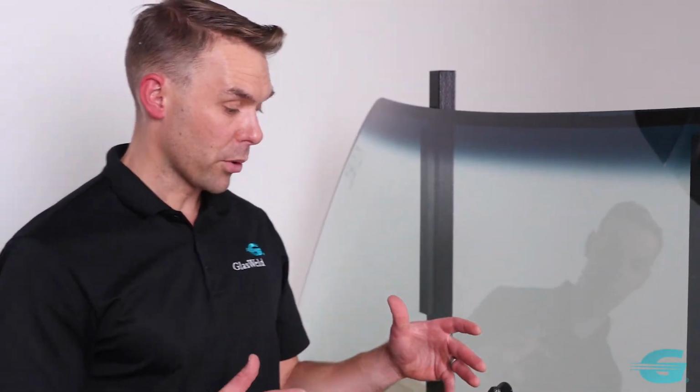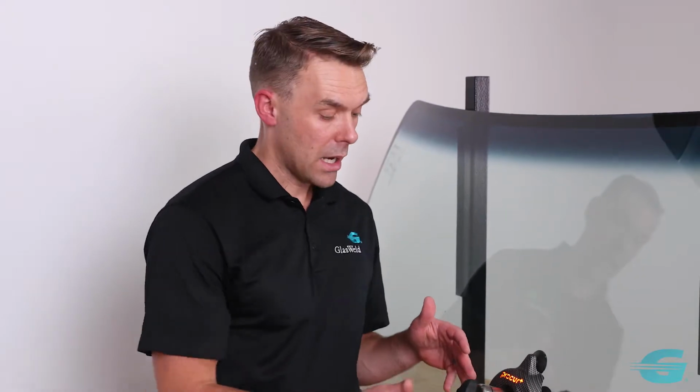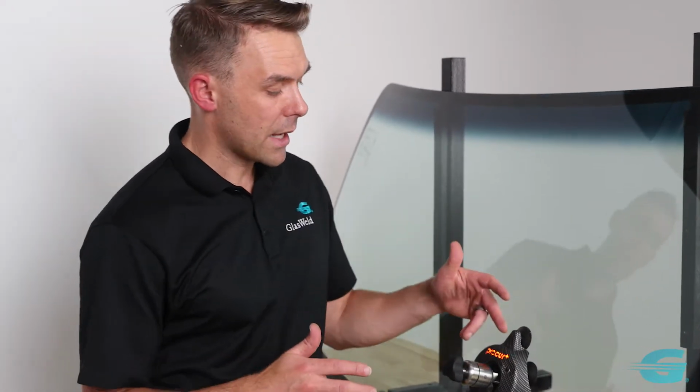Now the ProCure Plus light has an international patent pending on it, as well as the Zoom, and really that's all about the design there. It's got 15 high-powered LEDs that are all on a cross-hatching pattern, curing the break while the resin is still being injected, so you get nice resin pressure while you're curing the whole break, which gives you stronger, better looking repairs because it helps reduce resin shrinkage during the curing process.